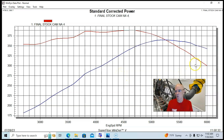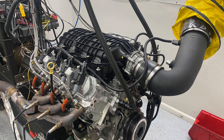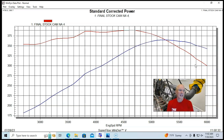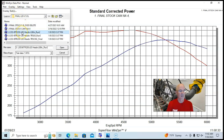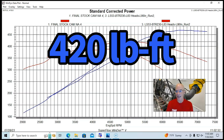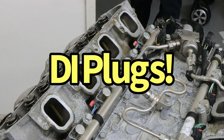Now let's see what happens when we do the upgrade. The guys from Brian Tooley Racing took L83 heads — the Gen 5 5.3 liter cylinder head found in a lot of truck motors — and installed them on this Gen 4 L33 LS block. Peak power went all the way up to 469 horsepower. Peak torque was up to 420 foot-pounds. They also used a BTR specialized camshaft and a Gen 5 cylinder head and intake manifold upgrade.